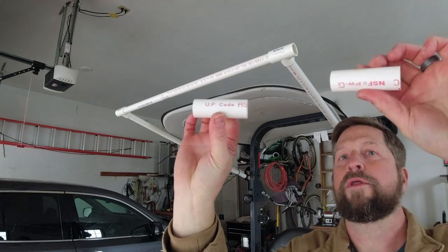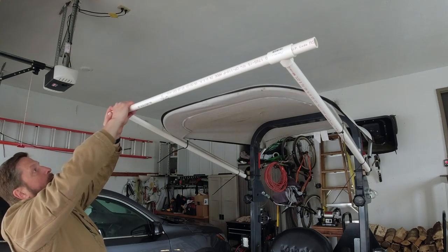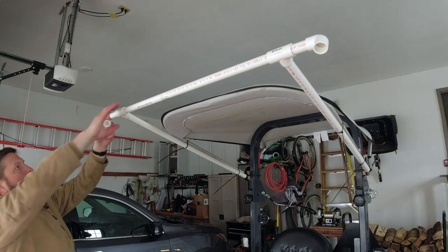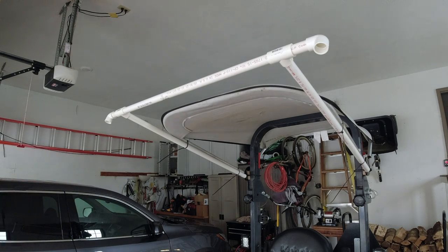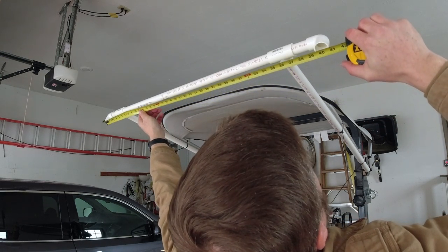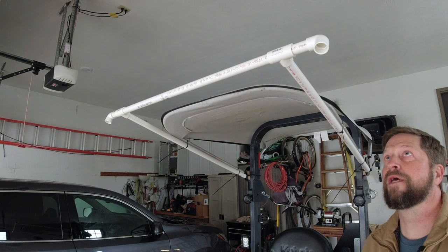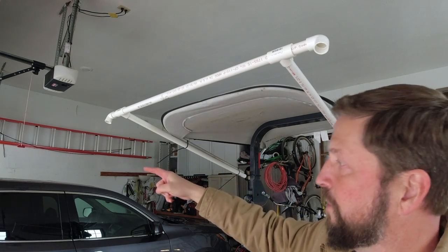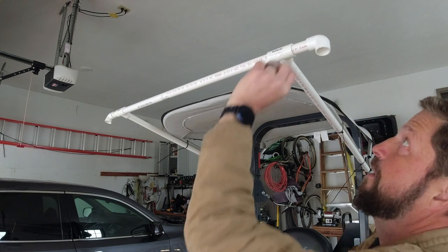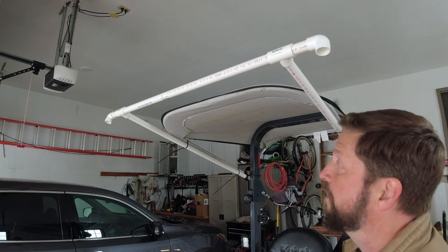Okay, so now I've cut two 3-inch pieces. They each go in a half an inch on either side. With the right angles on, like that, that should be close to 40 inches. Out to out, it's 40 3/4. I think that's going to be okay because the maximum for the golf cart said 41 inches. So this will be a full size windshield. If it doesn't work, you know, I can always go back in and trim a little bit off of this. I'm not gluing this together, not unless I have to. So, all right, let's make the frame.